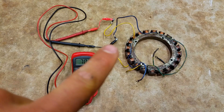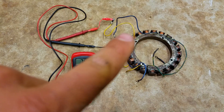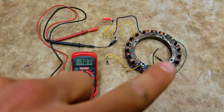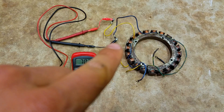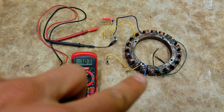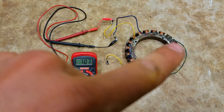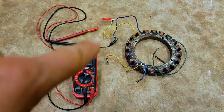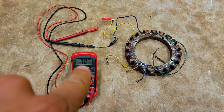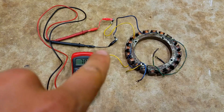This is the resistance of these two leads. These leads are connected together to the windings — they go around and are wrapped all around, coming out here. So we need to see if that coil is good from end to end. We hook up the multimeter and test the resistance because the wire has resistance all the way around. Hook up positive and negative — it doesn't matter which order for this test. The resistance reads 707 ohms. The range for this stator is 500 to 800 ohms, so we know this coil is good within its resistance range.